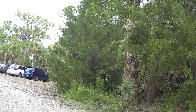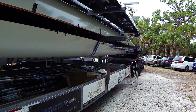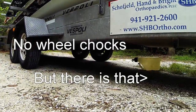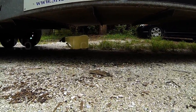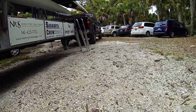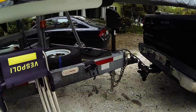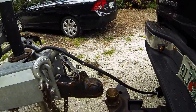We'll walk alongside the trailer, looking for anything obvious — make sure the wheel chocks are removed, that there's no debris or gas cans sitting underneath the trailer that we'd run over when we pull forward. Make sure we get the slings leaning against the trailer and load them in properly so we don't run them over. Also take the opportunity to walk ahead of the truck and clear the area for any low-hanging trees or posts sticking up that you might hit on the way out.